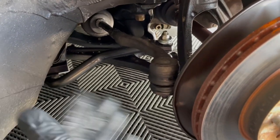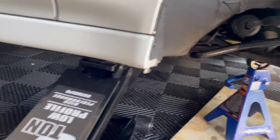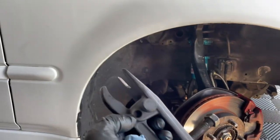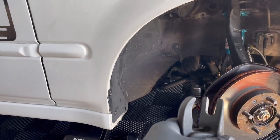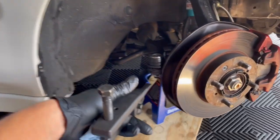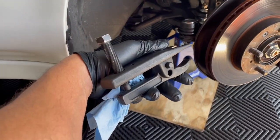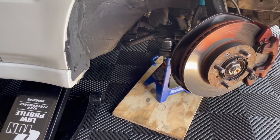I'm not doing a full video of how to do the job, I'm just going to do it and show you guys the results. One of the tools that I use — if you guys don't already have it, pick one of these up from Harbor Freight, not expensive at all. I use this for all my ball joints and anytime I take stuff apart. This makes the job way easier — you slide it in through here, apply pressure to that nut and it separates it for you. You don't have to smash it with a hammer or anything like that.